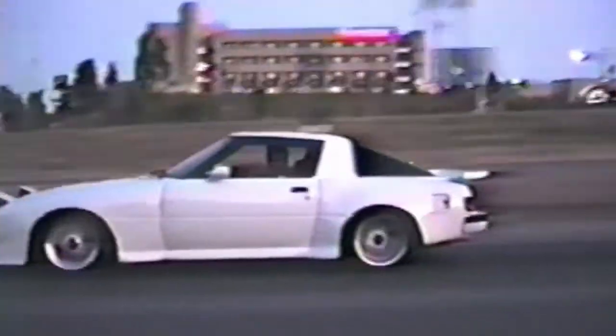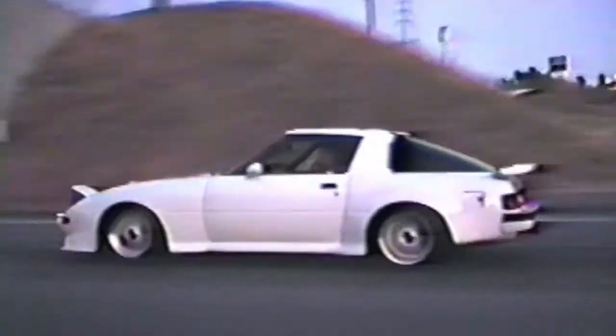And plus I haven't really gotten springs for forever, since I had my RX-7 back in the day. With all the cars that I've had, with the Evo, with the FRS, with the MR2, all those cars had coilovers. So if I had any issue as far as the drop height, or if it looked uneven, I could just adjust it. I could just go as low as I want to, or if it's too low, I could just raise it back up, or make the rear higher or lower, depending on how it looks.